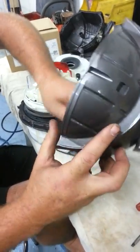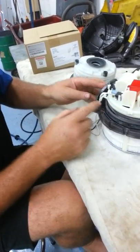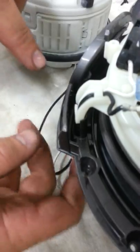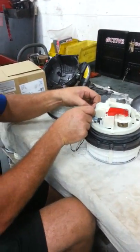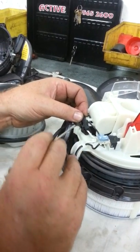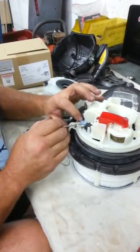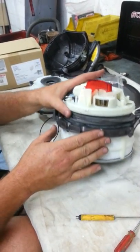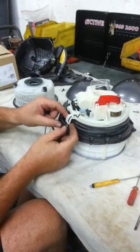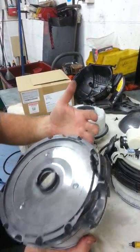That is basically the top section off - that's the hardest part. If you've gotten this far you'll be able to do it easily. I disconnected this wiring harness, pulled these wires off, and just pushed them through down through the little hole there - it all comes out. Once you get those, I pulled this case apart - inside there's just a little spade connection that comes apart in here. It's quite easy to get in there. Tuck it all back together, keeping everything the way it came apart. Once you've got it that far, I loosen this wiring off, twist this whole plate - there are a couple of little clips here you've got to watch. Just feed it past there and the whole base will turn out, basically unclip, and the new one clips in.